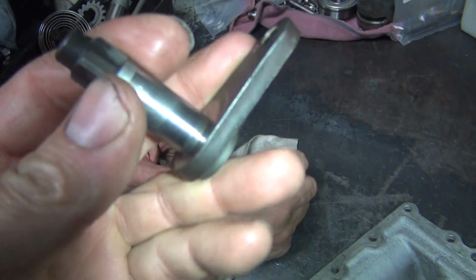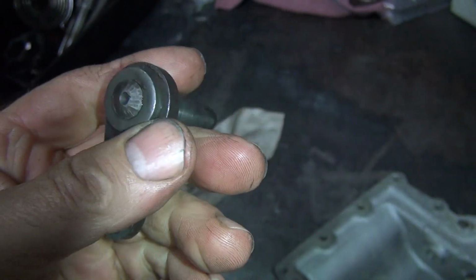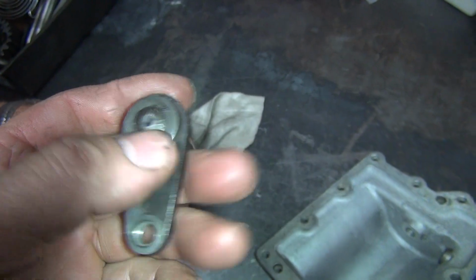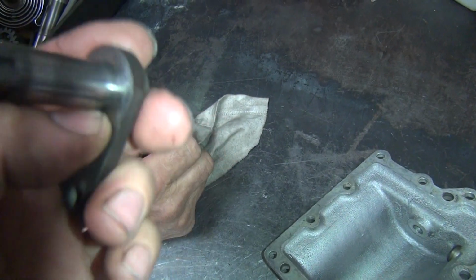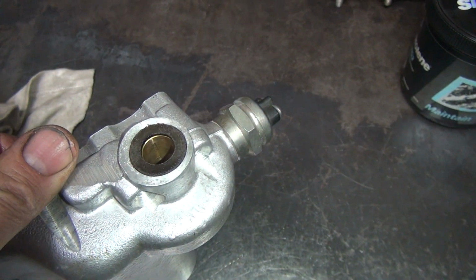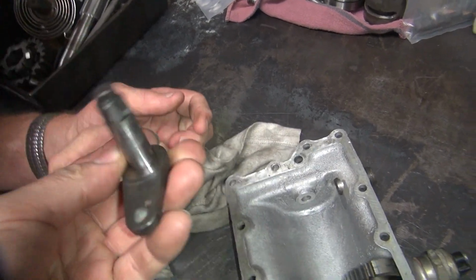You can see it moving around in the camera here on the post. And just weld on the outside here, I don't think it's the permanent fix. So we need to weld on the inside, but it basically sits flush right here. It's got to be welded. You got to sweat it in here.